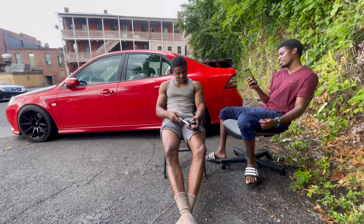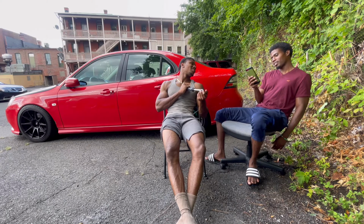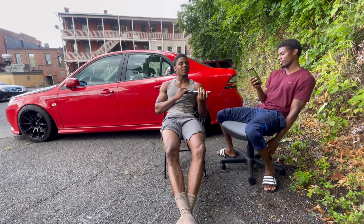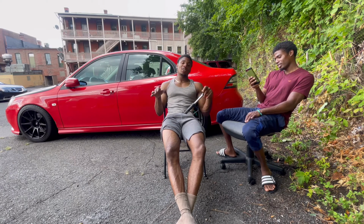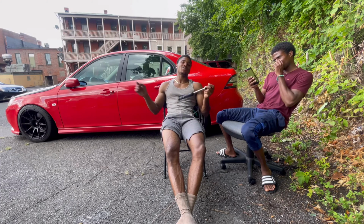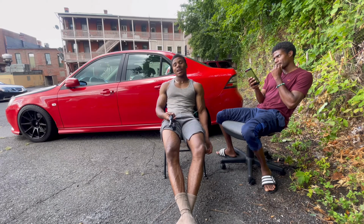The next question is, someone said, "Hey, good day. I'm looking at a Sport Combi 2.8 all-wheel drive. Do y'all know what power and torque limitations long term on this engine and trans?" Like he said before, 20 psi on E85, you're gonna make below 500, high 400 horsepower, and that's gonna last for a long time. If the one you're looking at is automatic, I honestly don't know how good the automatic trans are for power.